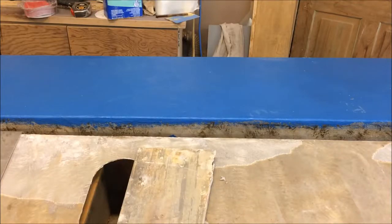I have some left over from my construction days — it's probably six or seven years old. We spent a while to get it mixed and applied it to the bottom very thick, probably 60 mils. We put it on with a squeegee and it took two or three days to really harden, but now you can't scratch it with your fingernail. I'm going to go ahead and coat the rest of the tank once we get the fiberglass in it.